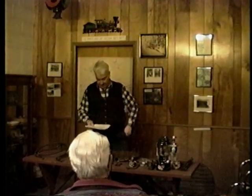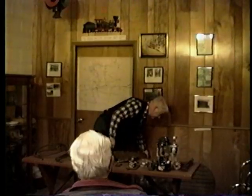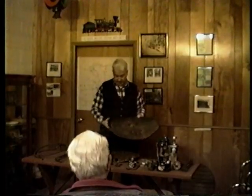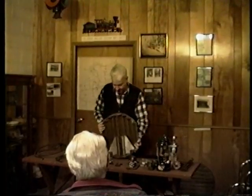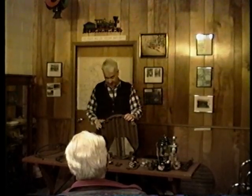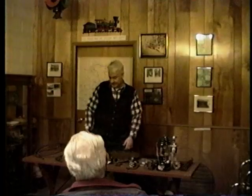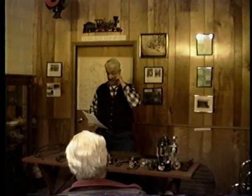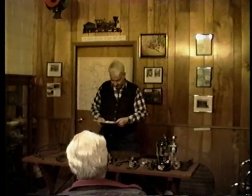There was an inside burner pan that was crimped to this burner plate. And we have one here for a different burner. But this pan, this is for a bigger burner, there's another one on the floor there, was crimped over this edge here on the burner. And what that did, that kept all the fuel that went in here just in here. None of it could leak out and get exposed to other air, outside air. And it was crimped on there and was also cemented on there to really make it airtight. And the idea was to keep it airtight, so that fuel didn't get mixed with anything else. If it leaked out, it would tend to backfire and do all sorts of weird things that you didn't want it to do. So that's one of the things that was very important.